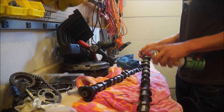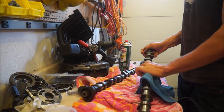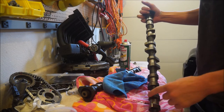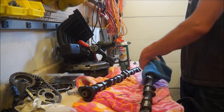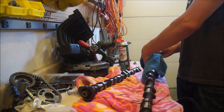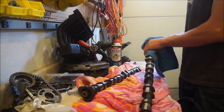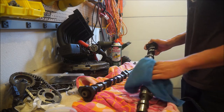To start with the cam, pretty straightforward — spray some brake clean on the lobes and on the journals. Basically anywhere that a bearing or a lifter will touch the cam, I'm going to clean. So clean your cam lobes and the bearing journals, get some brake clean on there, wipe them down real good. We are going to be using assembly lube — I recommend that you use assembly lube when installing these. We just want to make sure they have a very clean, smooth surface with nothing on it that can cause damage.